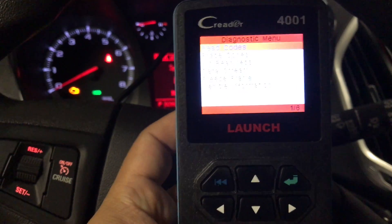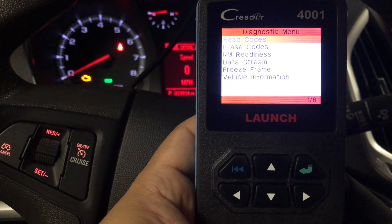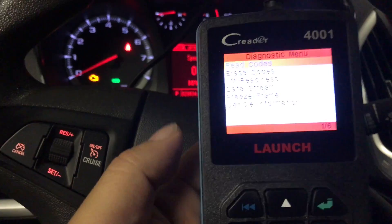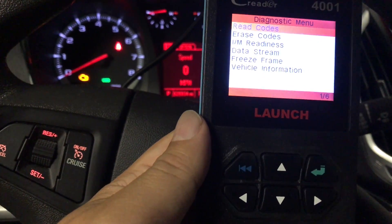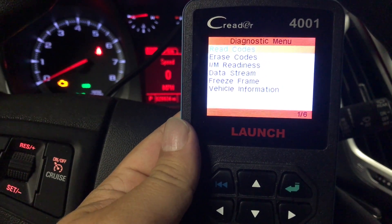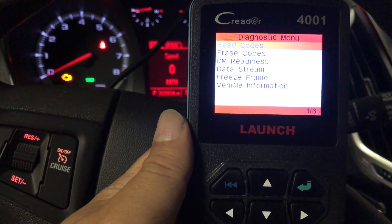Pretty awesome. I love it. I used to have an OBD scanner paying a hundred bucks for it. All it would tell me is P0102 or whatever it was, and you'd have to look it up afterwards. You can actually get all of that information and more on these things. I did plug it into the computer via the micro USB — you can actually go to the website and download the latest firmware for this if you want. That's really what it's meant to do: update the software. So you can get all the latest codes.